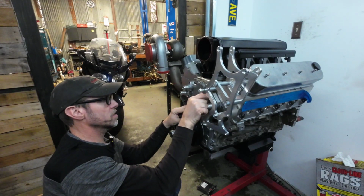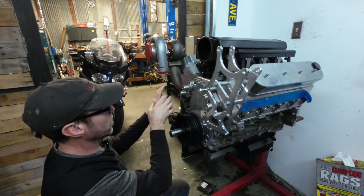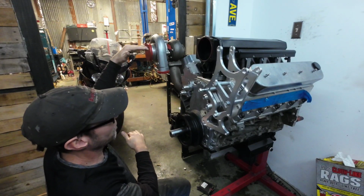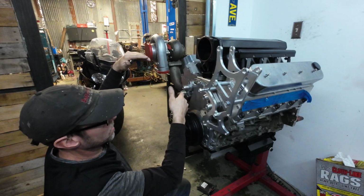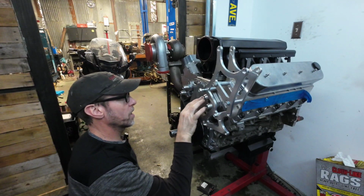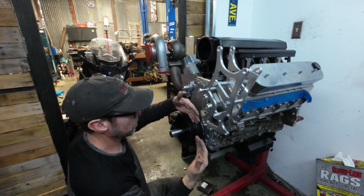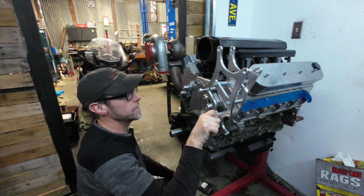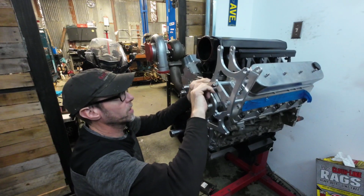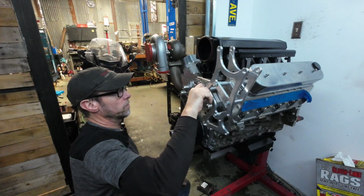Unless I get some O-ring 90 degree fittings, I could run them across over here and run all my water lines over, because my radiator is a dual pass, so both of my fittings are here. So I could 90 those and bring them across and then bring the belt on top of that, because they wouldn't stick out much further than this. Plus the belt is here. Yeah, maybe, I don't know, could be great or worst thing ever. This could be a horrible idea or really, really good, but probably nothing in between.